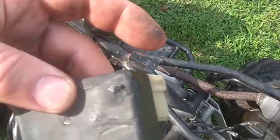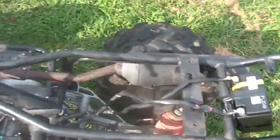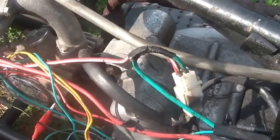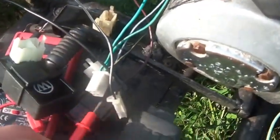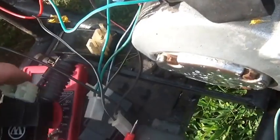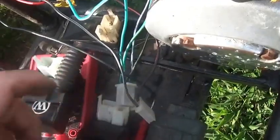I was thinking maybe battery power does go to the CDI, so I hooked to ground right through hooking up to the carburetor — one lead to ground, the other one. I checked all of these and none of those are hot. If I wanted to start it right now I'd just plug the good CDI in and turn it over and she'd fire right up — there's no issue with it starting.